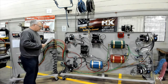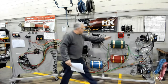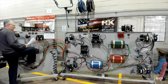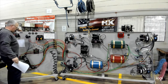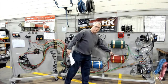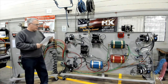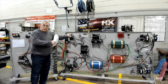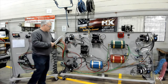The next thing is to apply the service brakes and observe the operation of the service brake chambers and the slack adjusters. Here are our front brakes and our rear brakes. We'll step on the brakes using the treadle valve. The rear brakes are operating — service brakes applied. The front brakes show no movement because we don't have any air in the secondary, which is our front air supply. The primary is for the rear brakes. Does movement of the brake chamber pushrods occur at the rear axle? Yes. At the steering axle? No — proper operation for a vehicle without an inversion valve.